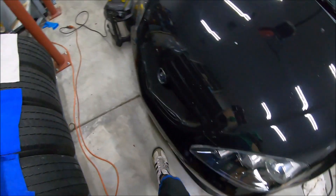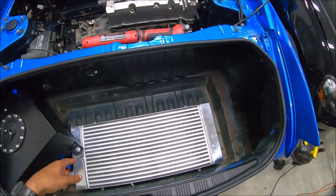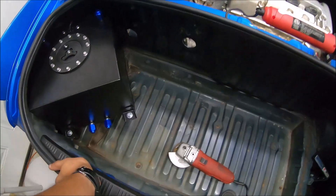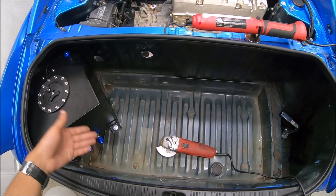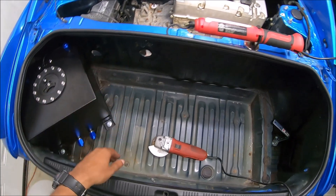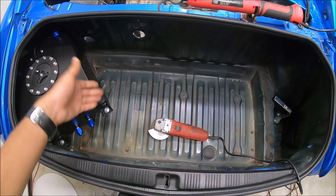We're at the point of no return — gonna get the other fuel tank in, make some brackets for that, then trace the intercooler with a marker, pull it out, and start cutting. We already have our scribe line in here where we're gonna cut. I'm gonna move this line in a little bit just in case — I can go farther later, but I don't want to cut too far because once you cut the trunk it's kind of gone forever.